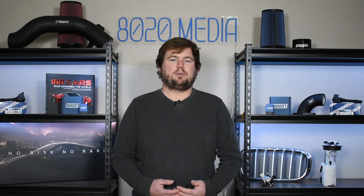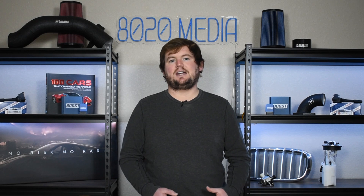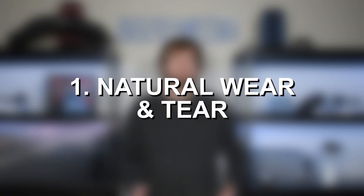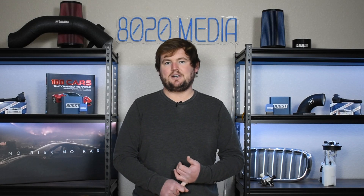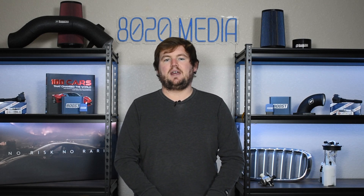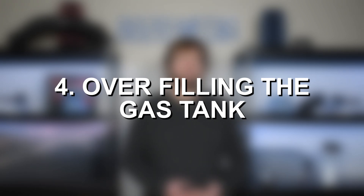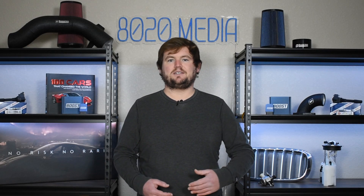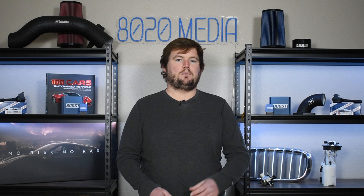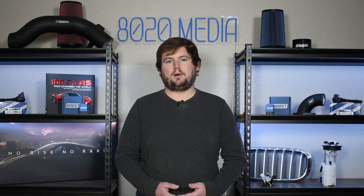What are the things that actually cause the purge valve to fail prematurely when it's designed to be a lifetime part? Some of this comes down to natural wear and tear — things like dirt and debris building up on or in the purge valve, contaminated fuel, or electrical faults since it's an electrical solenoid. One thing we can control is avoiding overfilling your gas tank. Overfilling can build up excessive vapors and push liquid fuel into the purge valve, causing damage and premature failure.